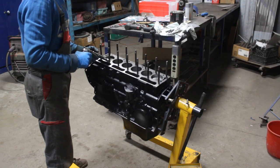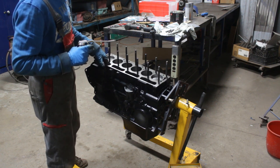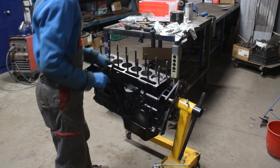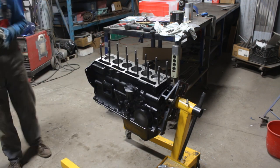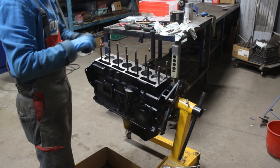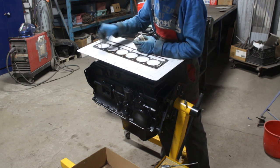Now that the timing is done I can continue assembling the rest of the engine. I started installing the cam followers and I was using a lot of oil everywhere, but as Chef Tash commented in a previous video, it's much better to use assembly lube — it's much thicker and it sticks to the parts and stays there for a long time, where regular oil drains down to the sump and then the parts remain a little bit dry. When you start the engine for the first time, especially if it sits a couple of days after you rebuild it, there is a high risk of starting it dry.